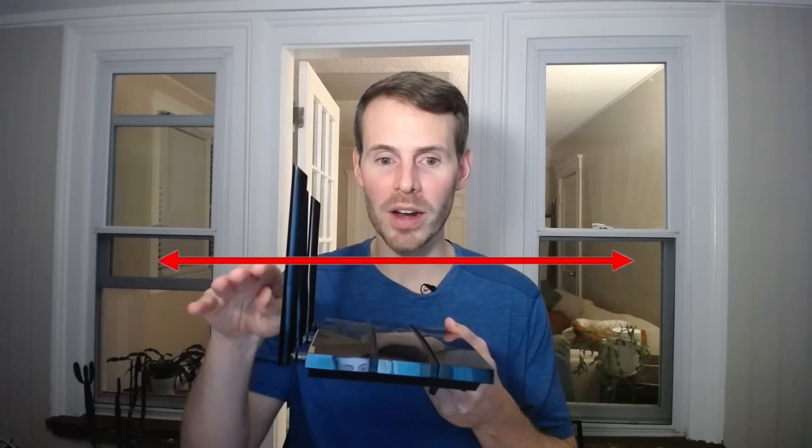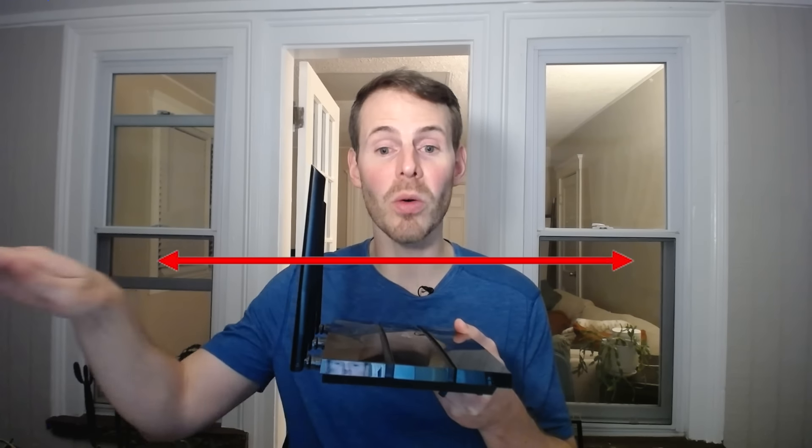Here's a classic example. My wife and I live on the third floor of our building. Some mornings we like to work out together in the basement — so we're talking three levels down from where we live. We like to watch workout classes on YouTube, so we need a wireless internet signal in the basement. When we first started doing this, my router's antennas were aligned vertically. And I didn't have great wireless signal in the basement — because the wireless signal was being broadcast in a horizontal plane, so none of it was reaching down to the basement where I was located.